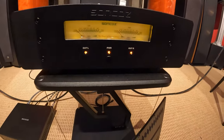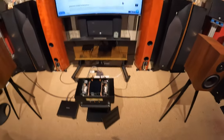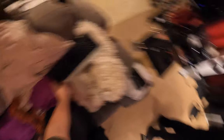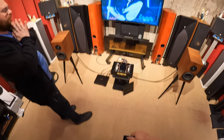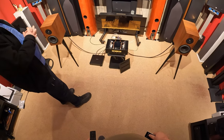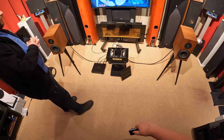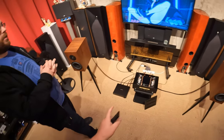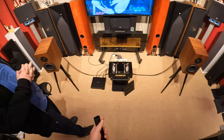I forgot this has a power button on top of it. It takes a second and then the lights come on the side telling you it's ready to go. Let's play something loud and see what happens. Chemical Brothers is currently playing. That shot up to 121 watts draw and then dropped back down to like 90 — probably 90% of it going straight into the bass.